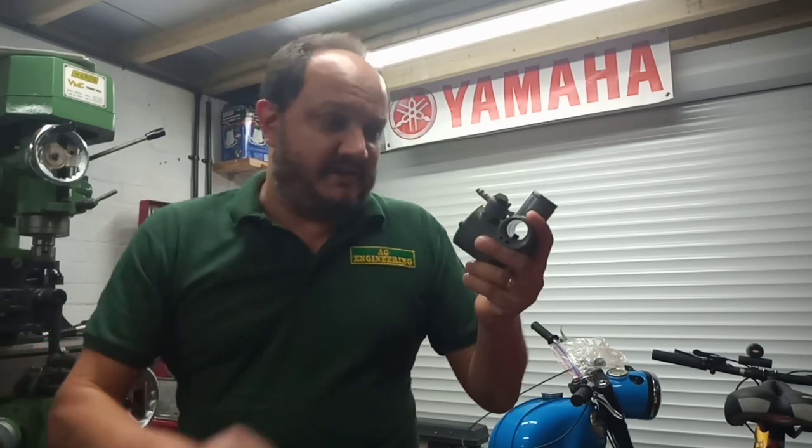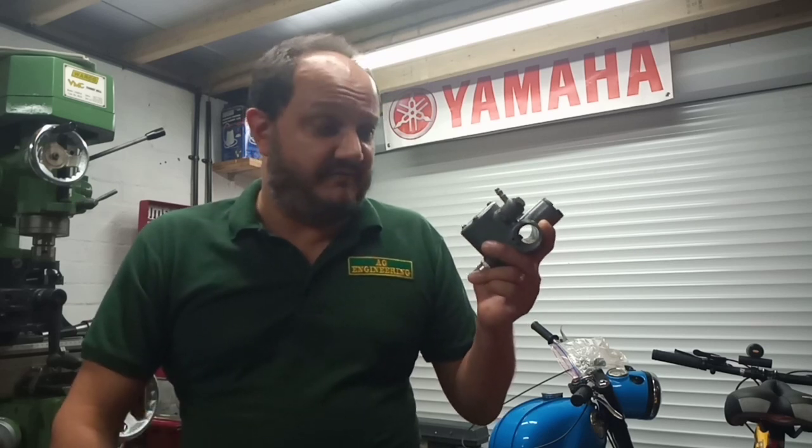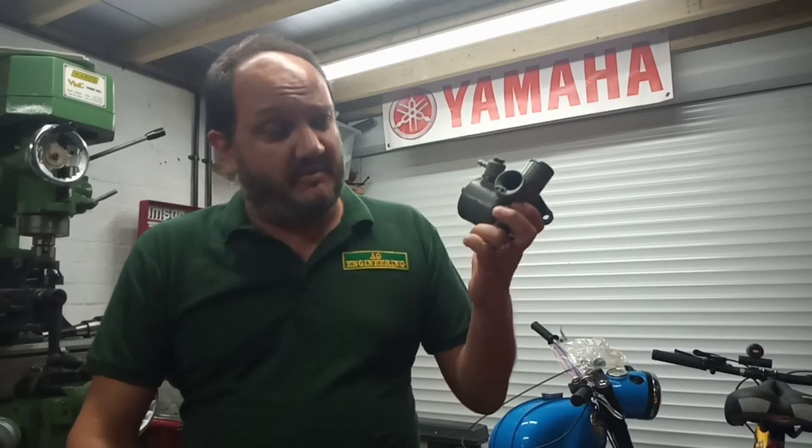I know what you're thinking — didn't he fit that in the last video? Yes I did, and here it is in my hand, so clearly something's gone wrong. I've been working on this already and I've done a procedure that the great man himself devised to cure a leak on the float bowl cover. When I had this fitted to the bike and turned the fuel tap on to flood the float bowl, it flooded the garage because the float bowl was leaking fuel as quickly as the fuel tank could fill it. I also noticed a leak on the main jet body, but the main event was the deluge coming out the float chamber.